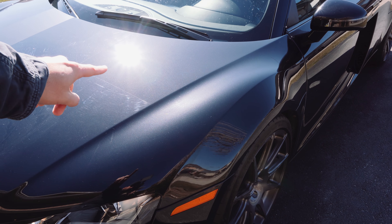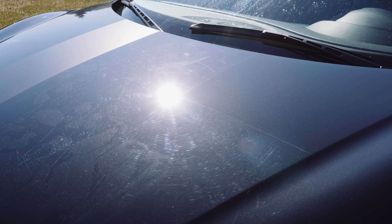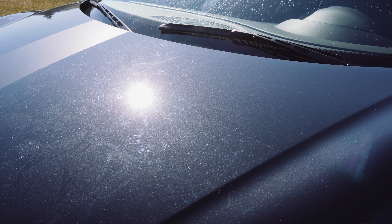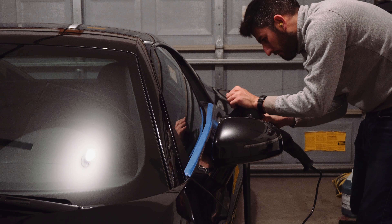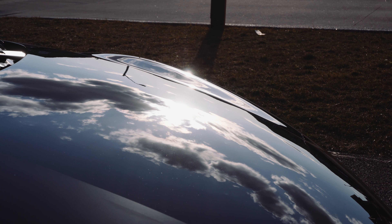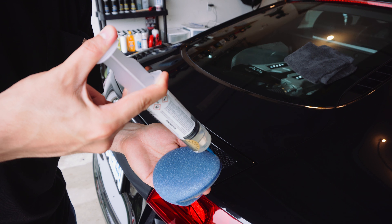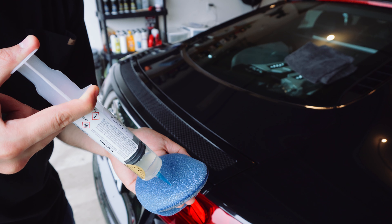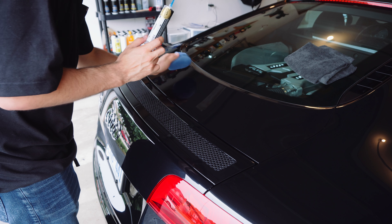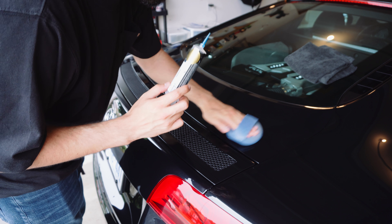There is a lot of preparation to do before you actually put on a ceramic coating. I did a full paint correction on the Audi R8 — the paint was in terrible shape, tons of swirls, scratching, and marring. I needed to get it washed, clay barred, and polished. This ensures the paint is at its absolute best condition possible, with all scratches and defects removed and no contamination baked onto the clear coat surface — so it's just the paint available to bond with the ceramic coating.